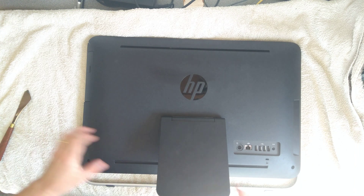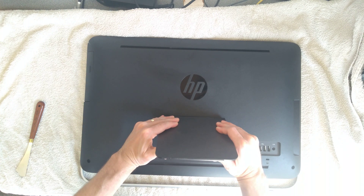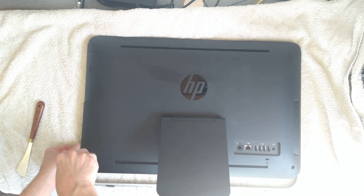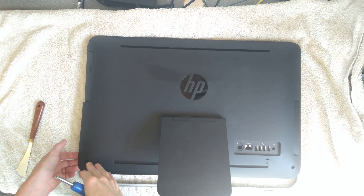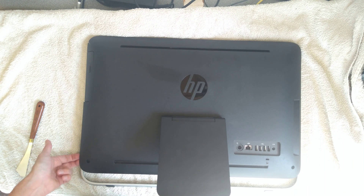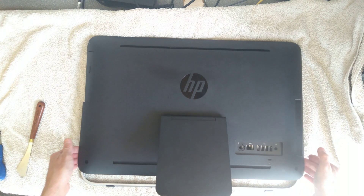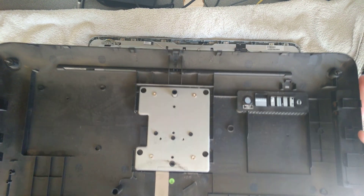That was an interesting way of doing it. It looked like I got the spudger wedged in, then I just kind of flexed the case almost by mistake while moving the stand and the whole thing unclipped and popped out. Make sure it's fully unscrewed there, because screws seem to do a good job of, when you put it back down without even moving the screw, somehow kind of biting in. I've just lifted that side up and unscrewed it — it's now fully free and moving. I'm going to do the same with the other side. So this entire case is now hinging up and off.